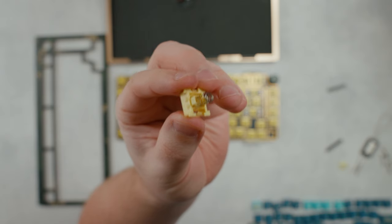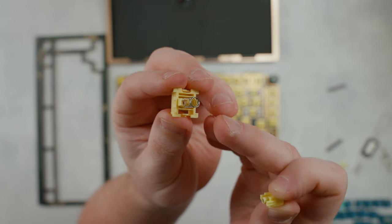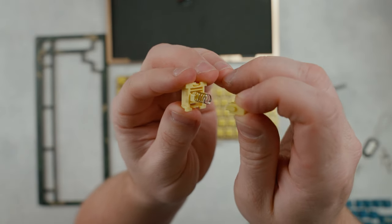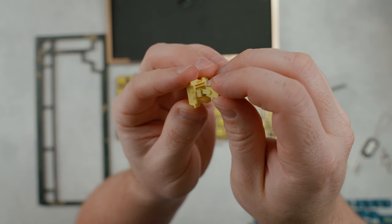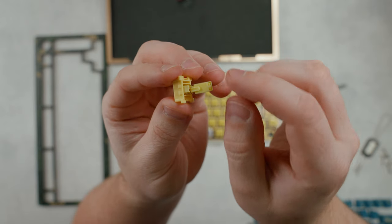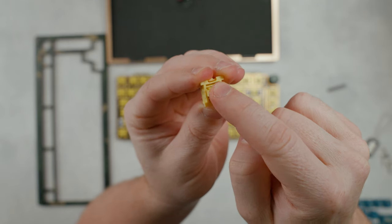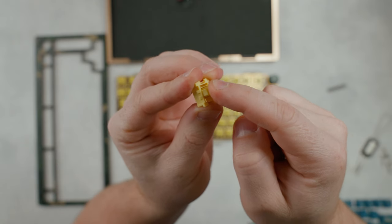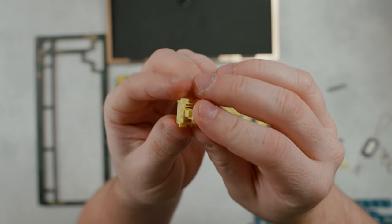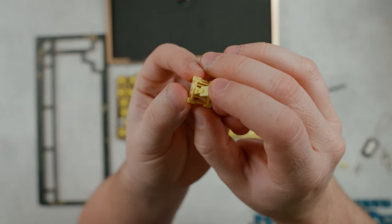Here's a look at the internals of the cream yellow switches. The spring is rated at an actuation force of around 50 grams, with a bottom-out of around 58 grams, so they feel a little stiffer on initial press. They don't give you the softest typing experience but they have a single-rail, wider-rail style design. They feel really solid and stable side to side, with just a little play up and down. They're very responsive on both press and release, and they do come pre-lubed — overall a really solid switch for gaming.